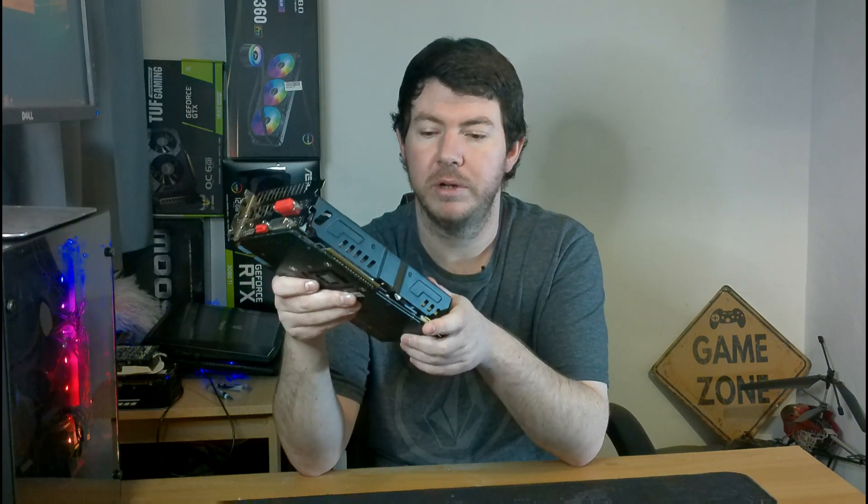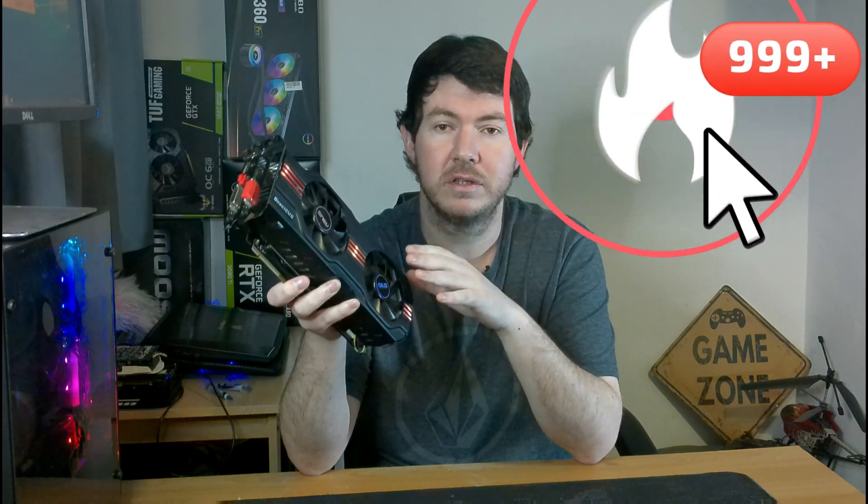What a fantastic episode, guys — this was extremely fun to make. I apologize: the part where I reassembled it and added new thermal paste didn't record. Sadly, I only noticed after I edited the video. In conclusion, the GTX 570 is still a fantastic card, but bear in mind this is 12-year-old hardware, so don't expect to run every single game at maximum. I could push the games fairly high, except for Shadow of the Tomb Raider, which is a 2019 title and quite demanding. Prior to cleaning, the card ran at 70 to 75 degrees Celsius. After cleaning, I got the temperature to drop to 50 to 55 degrees.